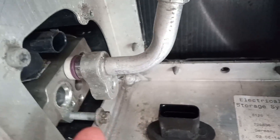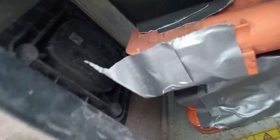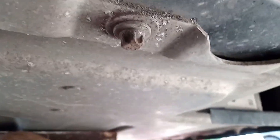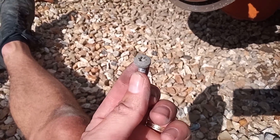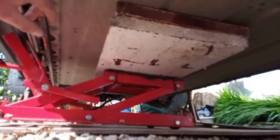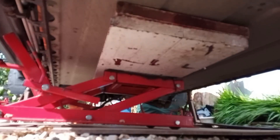Removing the battery pack - we've got two electrical connections up here and the refrigerant lines going in. There's the electrical connector that I undid ages ago. Then there were 26 bolts to undo - not a lot of room underneath at the moment because I've got the platform underneath. As well as all the bolts, there was also a screw in the driver's side rear corner, so don't forget that. I've been around and loosened all the bolts off with a ratchet, and now I can get the drill out and take them all the way out.